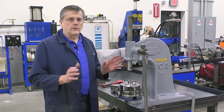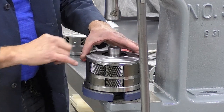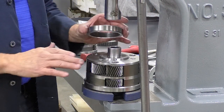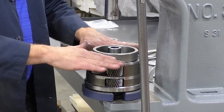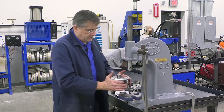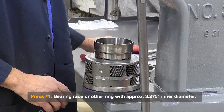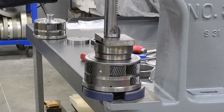What we're going to show here is a way to use your arbor press or other press to get these off pretty easily. First, we want to press right in this area and push the center portion down. I have just a bearing race that is just a little bit bigger than this diameter right here, and it's going to sit right about there. We're going to push it down, then come back with a little bit larger race to get this lube dam to pivot and pop up and pop off. I'll start with this smaller bearing race just outside this ridge and stack some stuff up. You can see that lube dam bend in there — that's really what we want to look for.